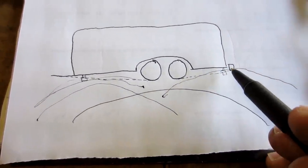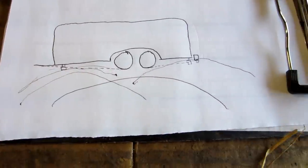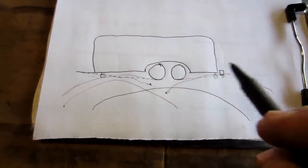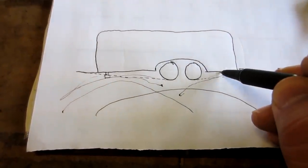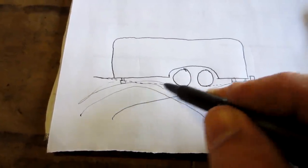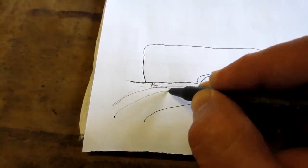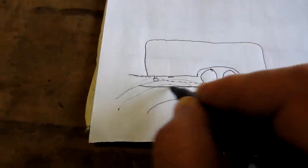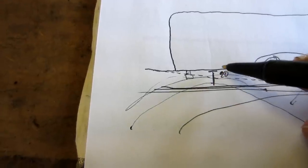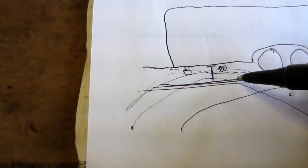Whenever you're exiting and there's a rise in the road, you want to make sure the bumper scrapes instead of the jack getting ripped off. That's why they make rollers for bumpers, because some people have areas where their campers are long enough that it causes them to drag. With that in mind, you're going to position the jacks within this imaginary line. The other thing is the height: 20 inches and under, you can use a 24 inch jack; if you are above 20 inches, you need a 30 inch jack.